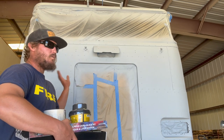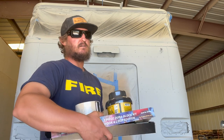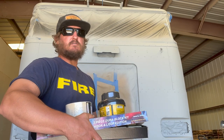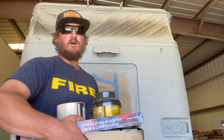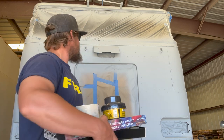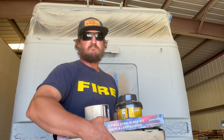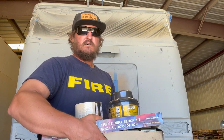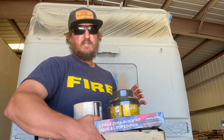We'll then go ahead and wash this thing back off, and then we'll do the wax and oil degreaser wipe down and get this thing back in the paint booth and get that single stage Omaha. It's my custom mix that I picked out at the shop, Omaha orange single stage. I'm getting excited, now that it's all one color and this thing's looking real sweet. So I'm excited. Stay tuned. We are gonna get to sanding a heck of a lot more and get this thing back in the paint booth.